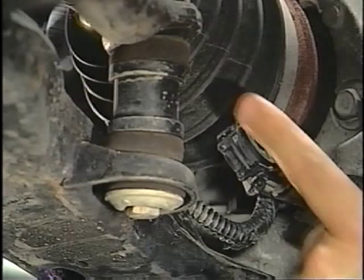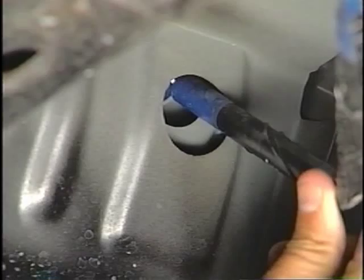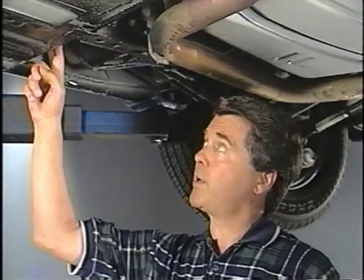While I'm under here, I want to mention another electrical condition that involves the ABS harness. The harness exits the body here at this pass-through. Over time, the harness could wear through as it rubs against these sharp edges. This could result in a short condition that would cause intermittent ABS operation and the resulting DTCs. You can use a piece of rubber or thick foam around the pass-through opening to form a grommet that would protect the harness from rubbing through.